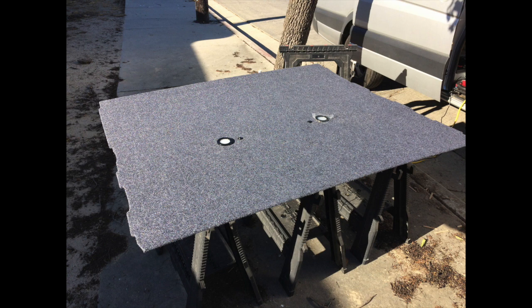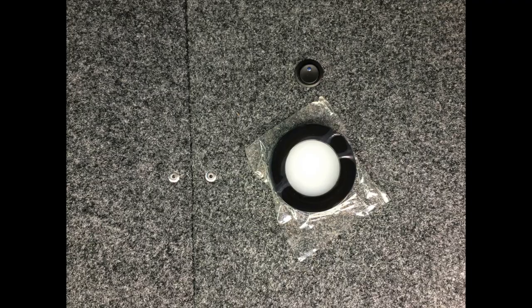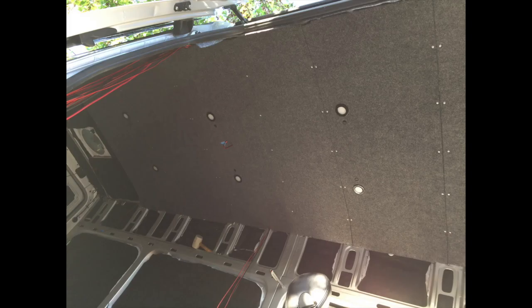One of the big things you can do is put individual switches on your lights. You'll see that each of those lights has a switch next to it. I have one main switch by the door — I turn that on and the lights come on as normal. But out of the 10 lights mounted in this van, I don't think I've ever operated more than three at a time. They're LEDs so they're very efficient, but what's more efficient than 10 LEDs? Three LEDs.